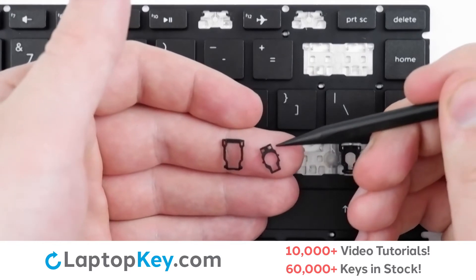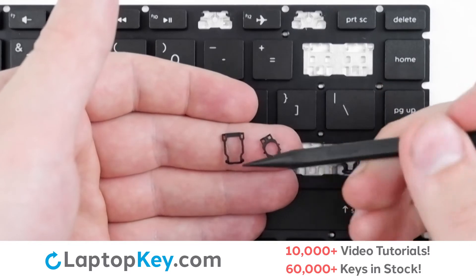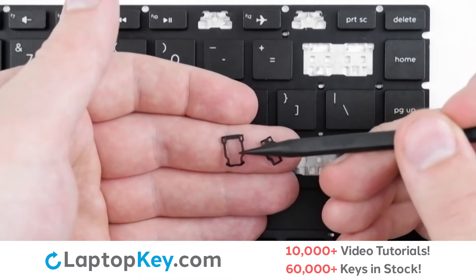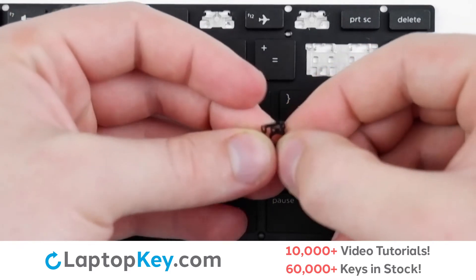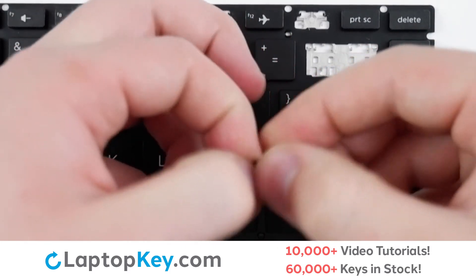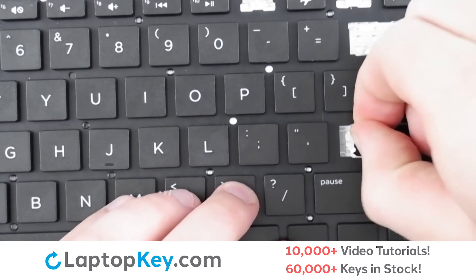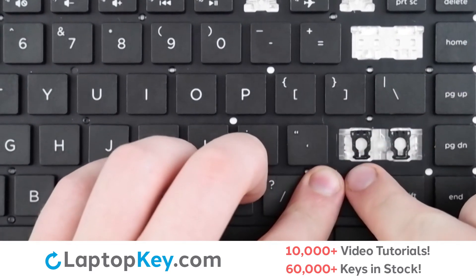To reassemble your clips, we'll begin with the top clip which has two holes at the top alongside a rounded edge, as well on the bottom clip, with two holes and the larger edge of the interior at the top. Simply line up the two halves, insert the arms of the top into the holes on the bottom. Then, using a metal hook at the bottom, you will lay the clip down flat, ensuring the hook is on the outer edge of the clip.